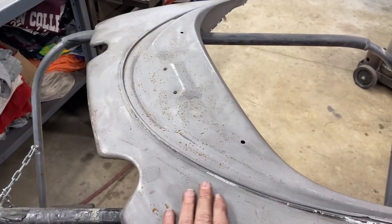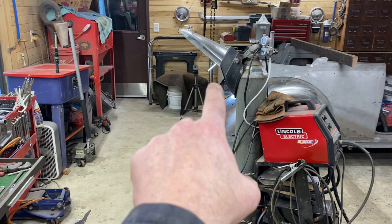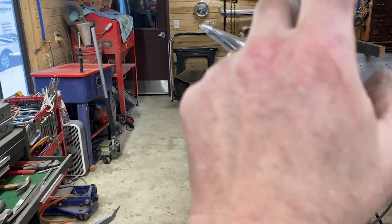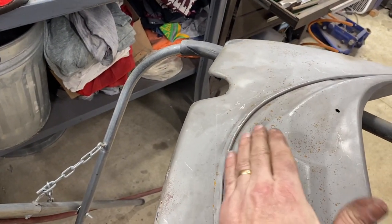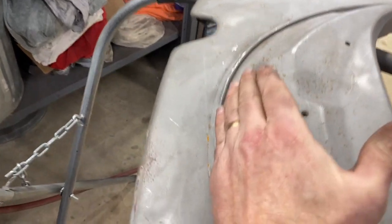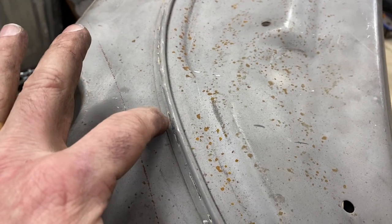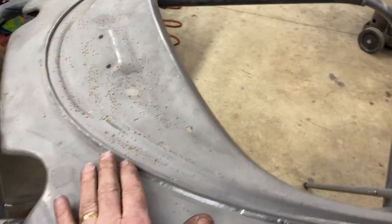We have a 66 rear apron. We have a 64 rear deck lid that was in better shape, and we liked the look and the handle and some of the features better. So the rear deck lid is closing, and it is not down far enough. And so the edge of the deck lid is resting on this channel that the seal goes into, as opposed to resting over the edge on where the seal will be. So that's challenge number one.